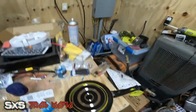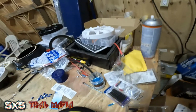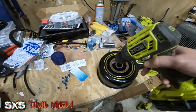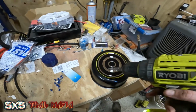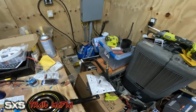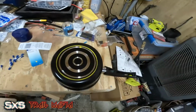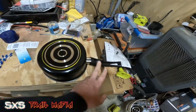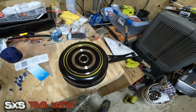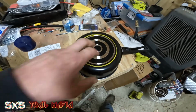I am using a drill. I will drill holes, 4 or 5 holes in this, 6 holes, whatever, just to make connection points for my jigsaw. Now I'll use my jigsaw over there and I'll cut out the hole. And I'm not taking the handle off until this is completely cut out, because that gives me something to hold on to while I'm doing this.